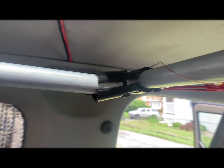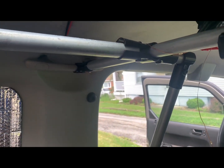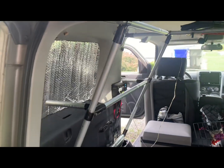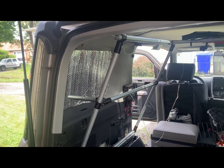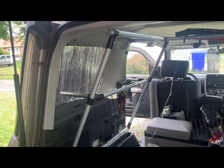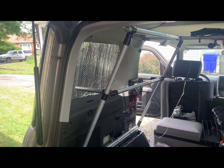I've added up all the pieces and haven't tightened anything down yet, so I can still slide everything around and make sure it's in the right position. Once it is, I go through and start tightening everything up. The last two pieces before putting the shelf on are just two horizontals that come out — scrap pieces, I think nine inches and six inches. They don't have to be precise because they only attach to one side and just supply some support. I took a level to everything to make sure nothing was sloping. But even if it does at a later date, it's easy — just loosen one bolt, slide it up or down, and you're good.